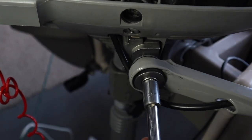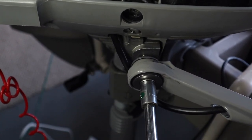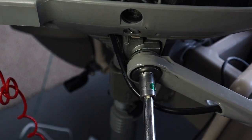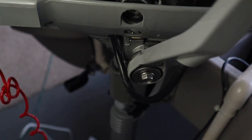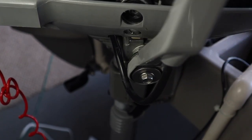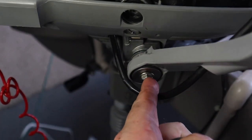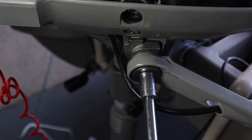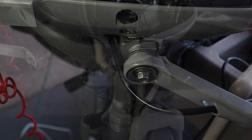Got my 12-millimeter socket. Hand tightening it so that I don't strip anything, then taking my wrench to tighten it on — but don't go crazy, I'm just trying to snug this. See how this can go back and forth but everything else stays in place? Because the two washers on each side that are lubricated are sliding back and forth. I've just got it snugged — just so it doesn't unscrew.